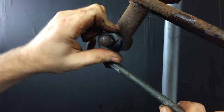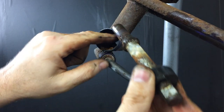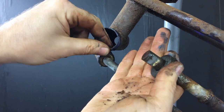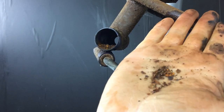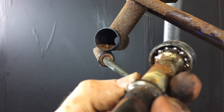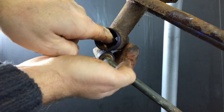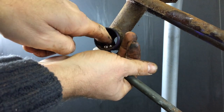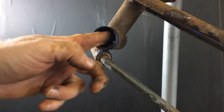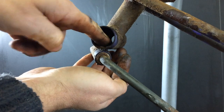Let's see what we've got inside here. That is very dry. Somewhere in there is a lot of powdered rust — you can see that. You can still see some ball bearings on that side, but all the rest have collapsed into the bottom of the crank case here. Obviously water got in, and there's also a hole in the bottom, so any corrosion from the seat tube could have also come down through there.